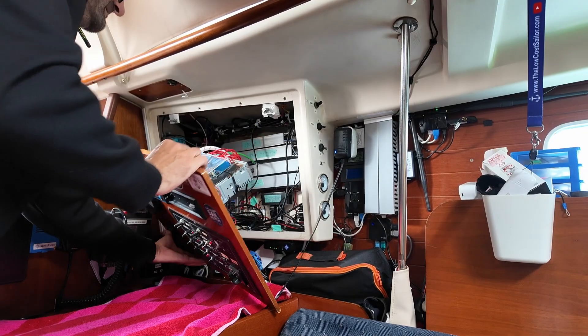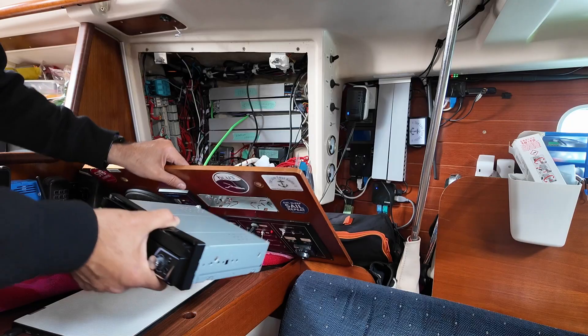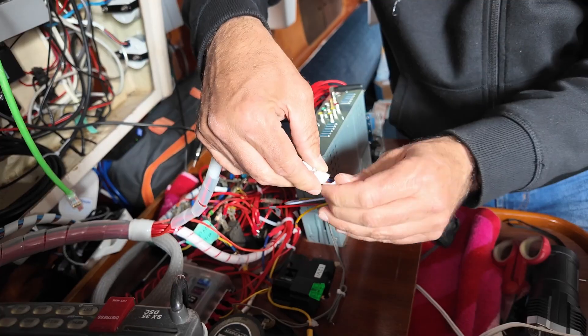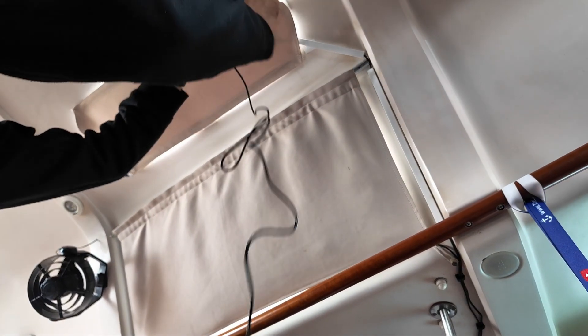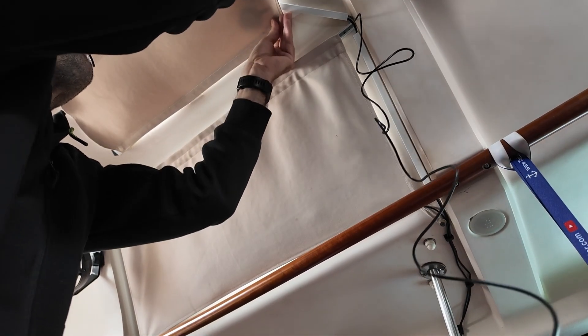On the radio itself there's a sticker with color codes explaining what each wire is for. The connection is really simple — since I already had a car radio, it was just a matter of replacing one with the other. It has dedicated wires for each of your speakers; in my case, two inside and one outside marine water-resistant speaker. You connect the small Wi-Fi antenna to its connector, and the GPS antenna, which you'll place somewhere with a clear path to satellite signals — in my case, stuck on the ceiling inside. And of course, the radio antenna for FM.